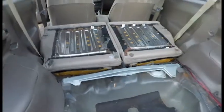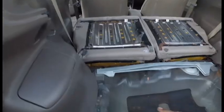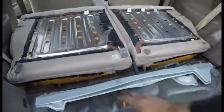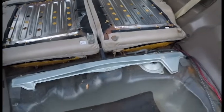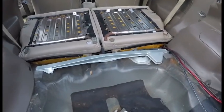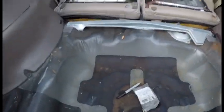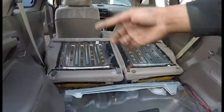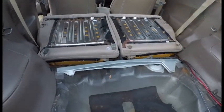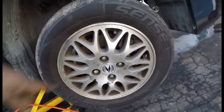We have a roll cage. It's currently being bent. SOW Race Cars of Pennsylvania. I'll pick that up next weekend because once I cut this out, the car will be extremely loose. It would be in my best interest to reinforce the chassis with the roll cage. The roll cage is going to be the firewall. The roll cage is going to be the motor mounting points, and then add rigidity to the car. So it's solving a lot of problems for me.